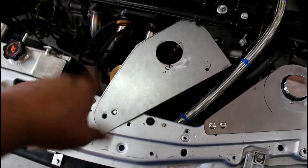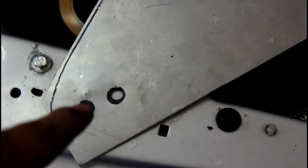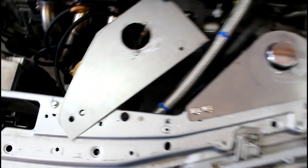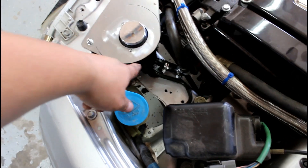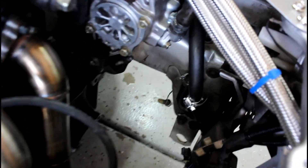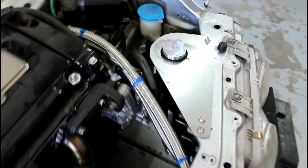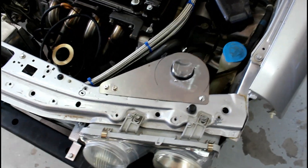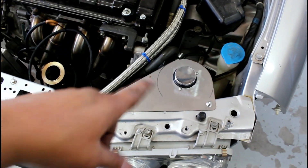We changed out the power steering reservoir to a Mishimoto unit. We first made a cardboard template, then a first metal template — the holes were a little too far apart on that one — so we shrunk it down and it looks clean now. The hose comes out, up and over with the stock hose into the pump. On the return side, I used the factory lines, got rid of the second hard factory line, put in an adapter, and routed it into the other side. Looks pretty good.